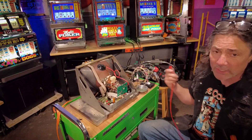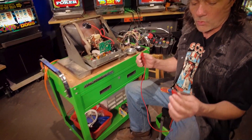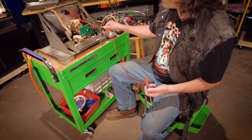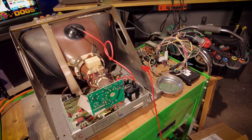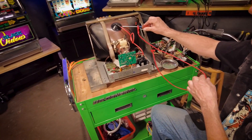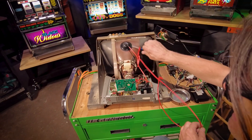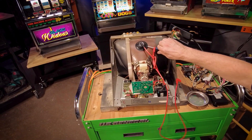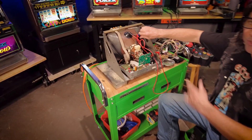It's really simple to do this. All you need is a screwdriver and a cord with some alligator clips on it. One end of the cord goes to the chassis of the metal frame of the machine. The other one slips right in under the anode cup like this. And once it's made contact with the metal connector inside, that has now discharged the monitor. It's really that easy.